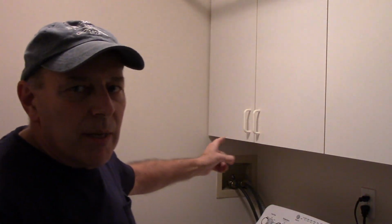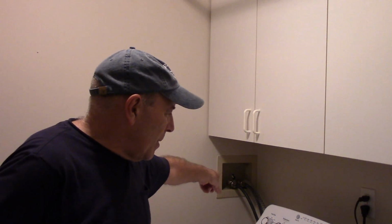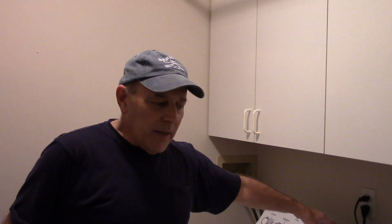Today is a little bit of preventive maintenance that is a good idea for everybody to do. I don't know the exact time frame when they recommend doing it. Myself, I usually change them every 3-4 years, depending on the amount of use that you're actually doing. And what we're talking about today is hoses, the hoses that actually connect up to the washing machine. You can see in the back over there, the hoses go from here to the back of the machine over here. So what I'm going to show you how to do is to change these hoses. It's a very simple job that anybody can do.